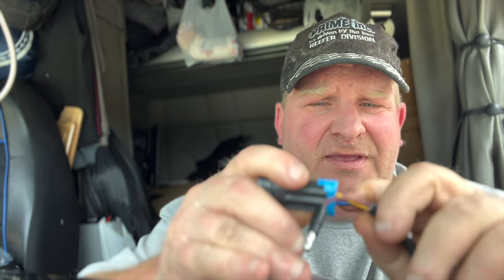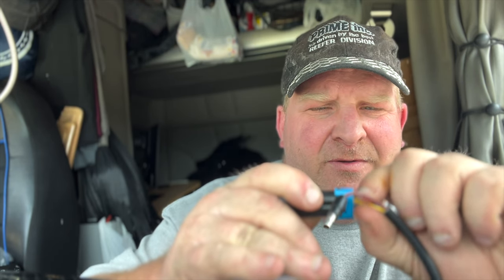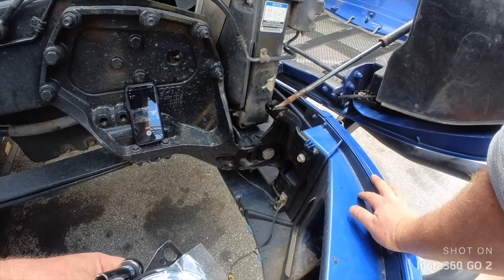I'm going to say these fit the 2021s and below. I used to have a 2013 587 and these will fit those too. If it has the round fog lights on it, these are factory replacements — not OEMs, but they have the same mounting system and will fit right on. So that's what we're doing today. If they don't work, don't panic — I'll show you how to fix it, because a lot of times on aftermarket fog lights the wires are switched. All you have to do is swap the blue and green wires in the connector.